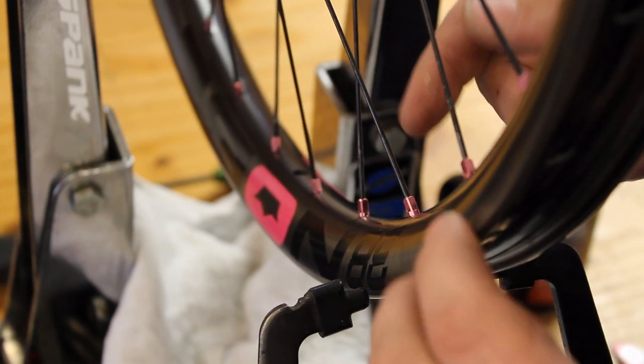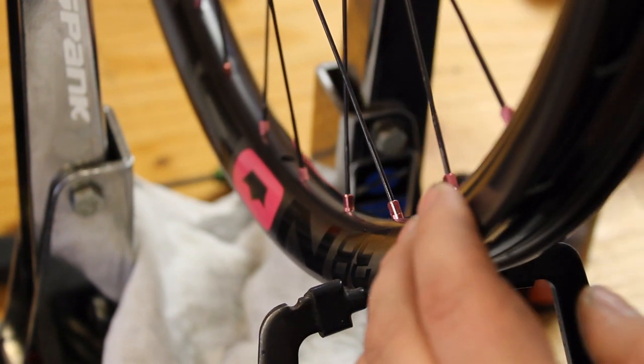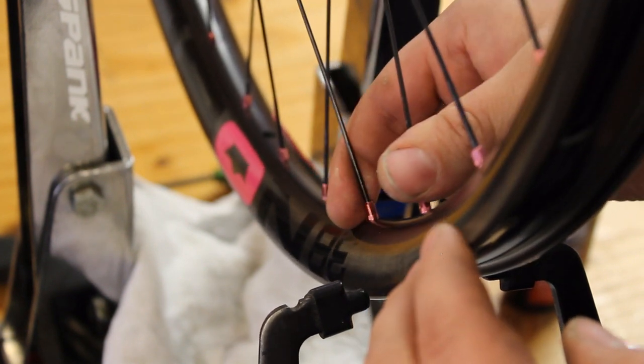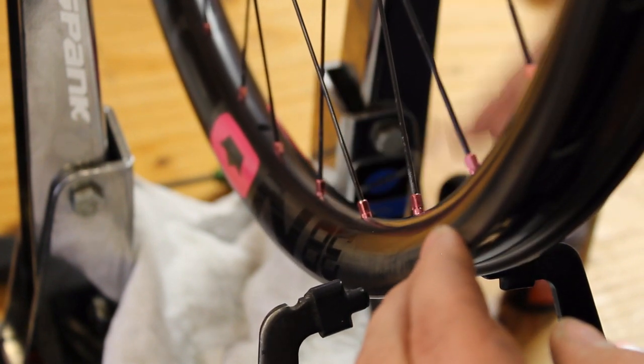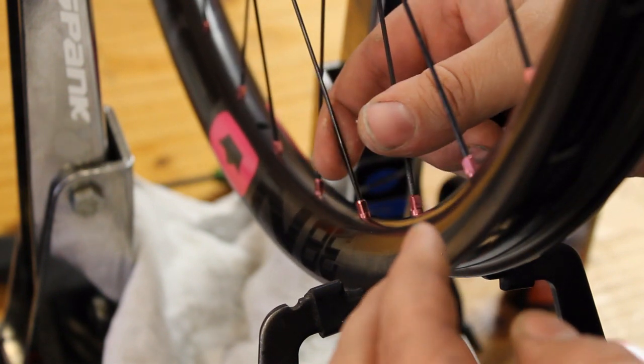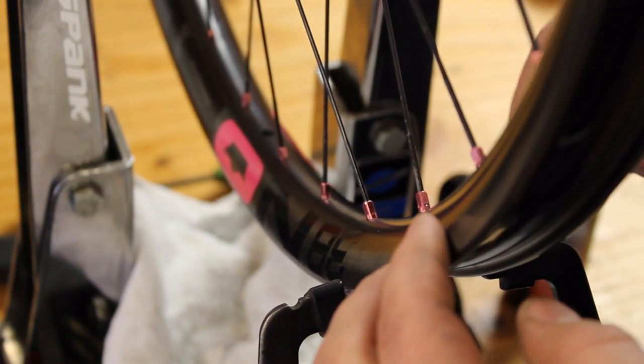And then on the vertical true, if you want to pull the rim in towards the hub, you tighten two pairs, or a pair of spokes, and then I'll bring the rim up a little bit. If you want to let the rim relax a little bit, you take those two pairs of spokes and you were to loosen them a little bit.